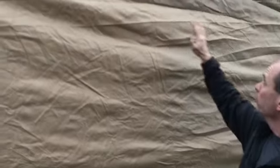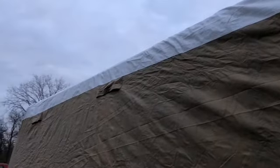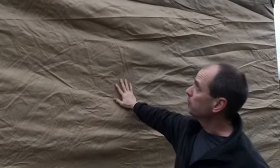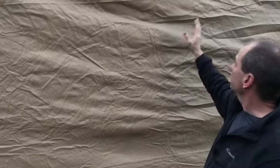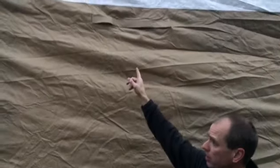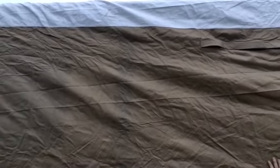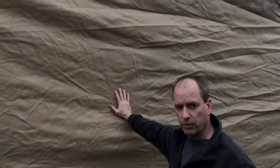You notice up here we're pretty even all the way from front to back with that Tyvek cover overlapping. That's going to be about the same on both sides, about 6, 8, 10 inches, somewhere in there. It might be a little less depending on where your AC unit is, but that is just to keep repelling of the water. And also you'll notice here these little slits on down the side here. Those are air vents. There's air vents on the rear and both sides of the travel trailer to let moisture get out and evaporate through the year.